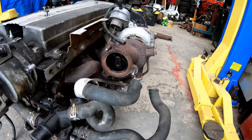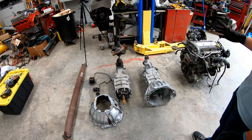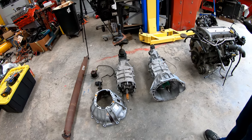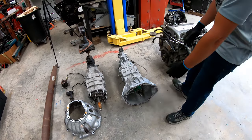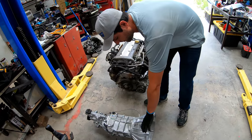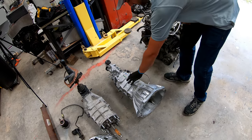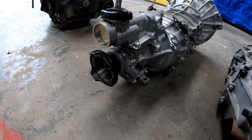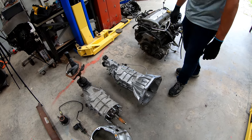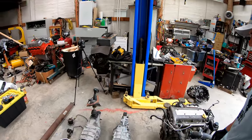Go through this engine into rear wheel drive. Our only options were either a Solstice or Sky transmission. And this is a Pontiac Solstice transmission. I think it's the AR51. This bell housing will bolt up directly to the Ecotec. The problem with this transmission is the output shaft. Here is a CV torque tube type, which would be a little bit extra work when it comes to getting it in the El Camino.